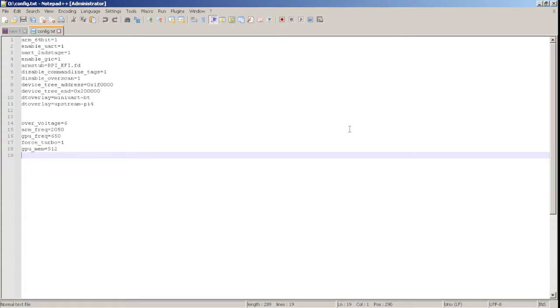For time, I've tested a ton of overclock settings, and I've picked what I wish to use as a base clock for all of the Pi 4s in my cluster. For those of you asking, why not overclock to the highest settings and just leave it? Well, the answer is simple. First, not all of the Pi 4's hardware are equal. I know on paper the specs are all the same, but I've got Pi 4s that will not overclock past 2 GHz, and I've got some that are fine past 2.1 GHz.